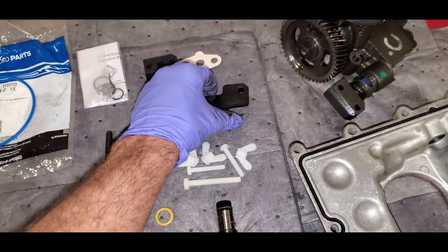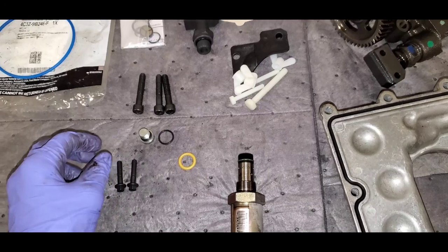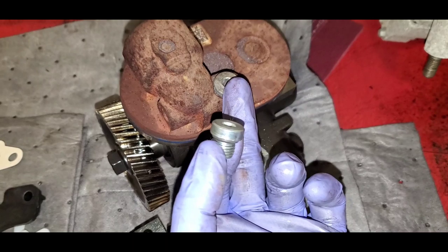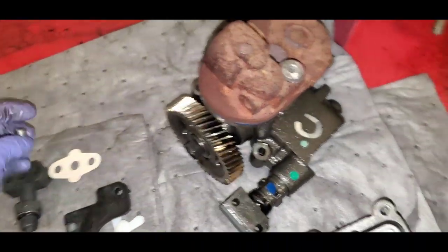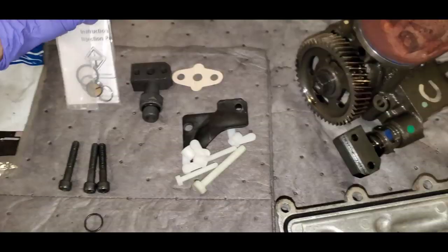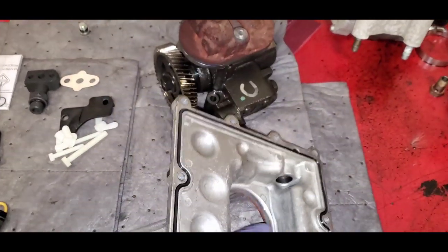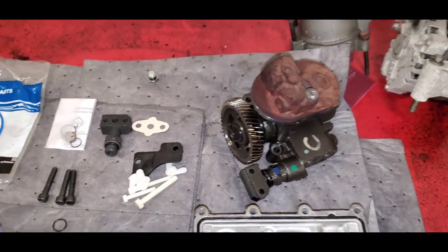You guys can see it comes with a little plastic bracket to keep everything in line, new bolts for the adapter pump, two o-rings under the pump. I don't replace or take out this plug — you can check high pressure oil pressure with a gauge. I just leave that plug in there. It also comes with new IPR seals. We're going to go ahead and break those down, and a pump cover gasket that I've already installed and cleaned and prepared for installation. So I'm going to go over the steps you need to do to replace this and get it reinstalled back into the truck.